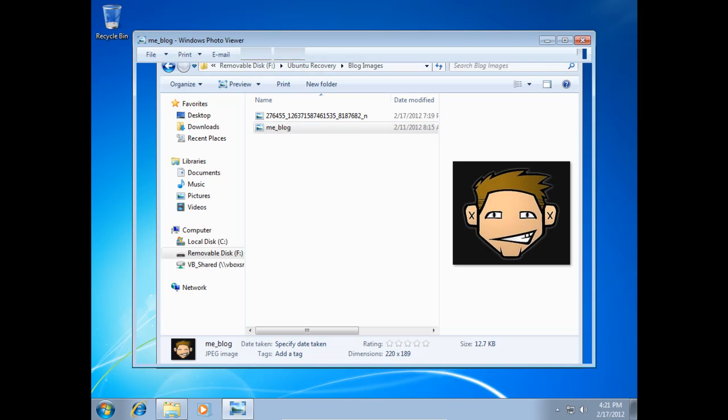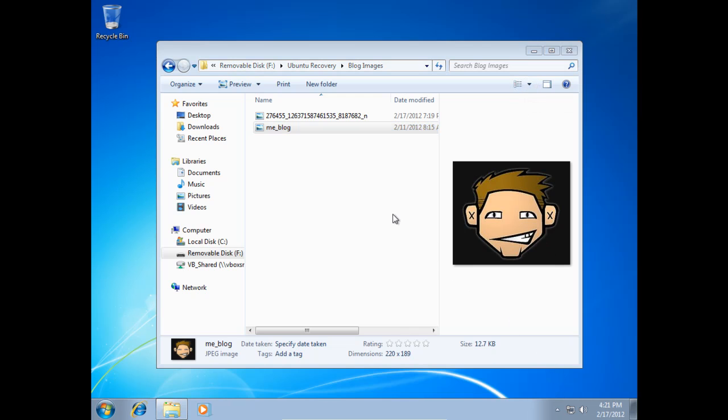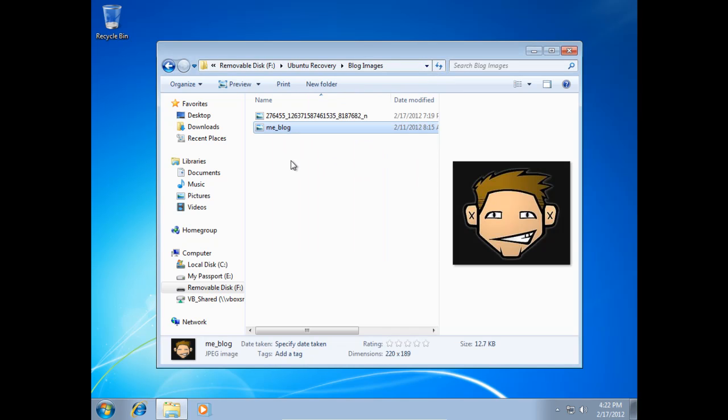So that's it in a nutshell. I've seen people who charge quite a bit of money to recover files. Do yourself a favor — next time you have a problem and you have a live Linux CD laying around, why not give it a shot first? Really all you need is a live CD and a USB flash drive or external hard drive. Save yourself a little trouble and maybe a little money. A live CD is one of the primary tools I keep with me when I bump into computer problems — they're handy. You can do all kinds of things from launching antivirus to rescuing files, and you can also get into partitioning with certain Linux distributions. Knoppix has great hardware detection for newer and older machines, whereas Ubuntu has better detection for newer machines and runs a little slower with the inclusion of Unity, but works great on newer hardware within the last couple of years.